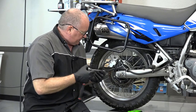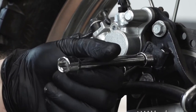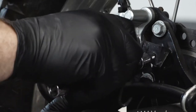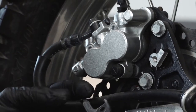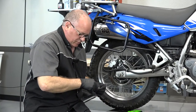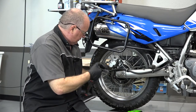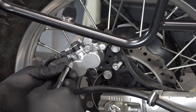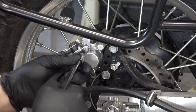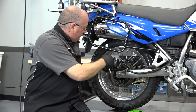Alright, let's get these brake pads swapped out. Go ahead and get this bracket out of the way, otherwise it makes it really difficult to get down to that lower bolt that holds the caliper bracket. But before you remove that, let's go ahead and break loose these two pins that the brake pads actually ride on, because it's a lot easier to do it out here with it still mounted than after you remove those two bracket bolts.